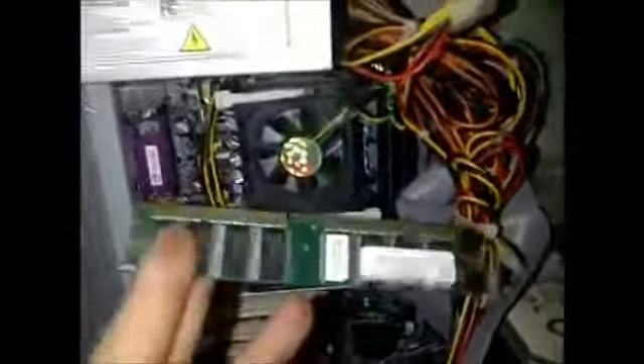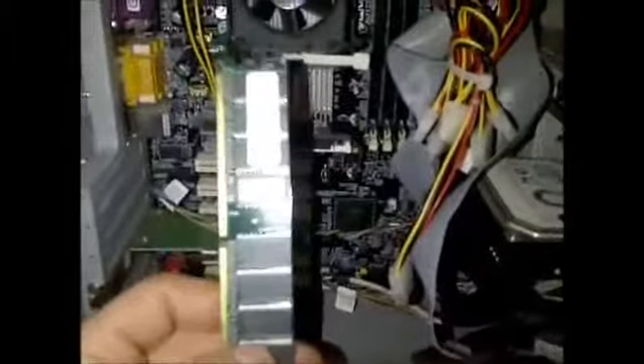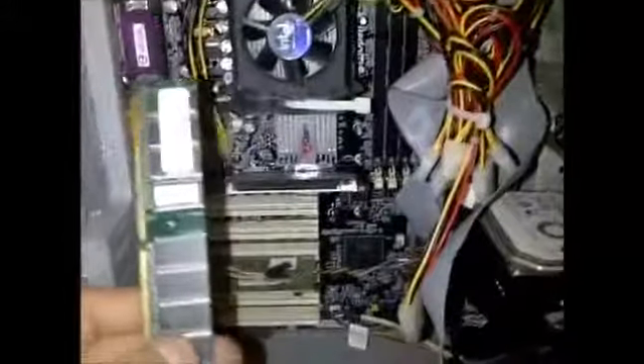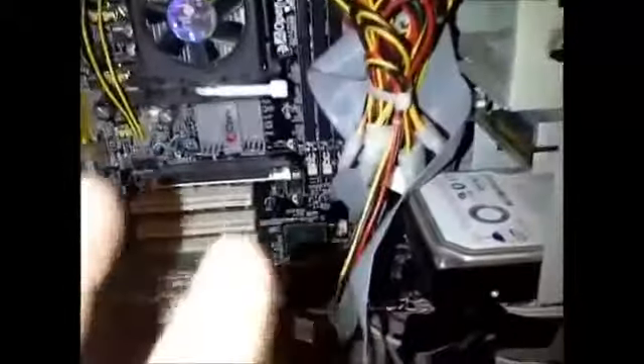RAM chips can go bad quite often. I've seen more than one fairly new one go bad, and you'll chase the problem around replacing things like your power supply, hard drive, and video card, when it actually turns out to be bad RAM. The best test for RAM is memtest.exe — it's a very small and easy program. It usually determines if RAM is bad within about 30 seconds.